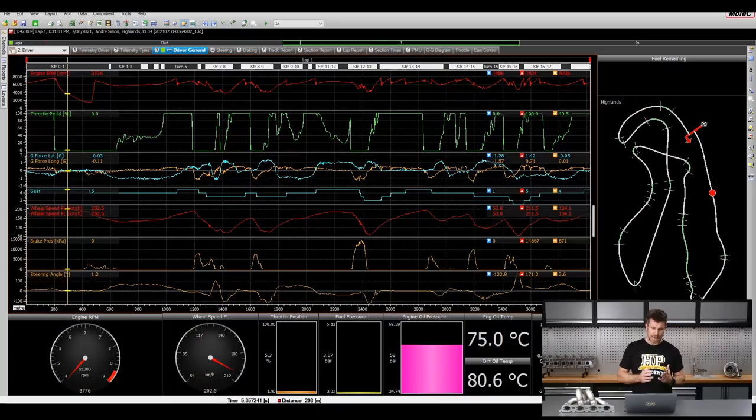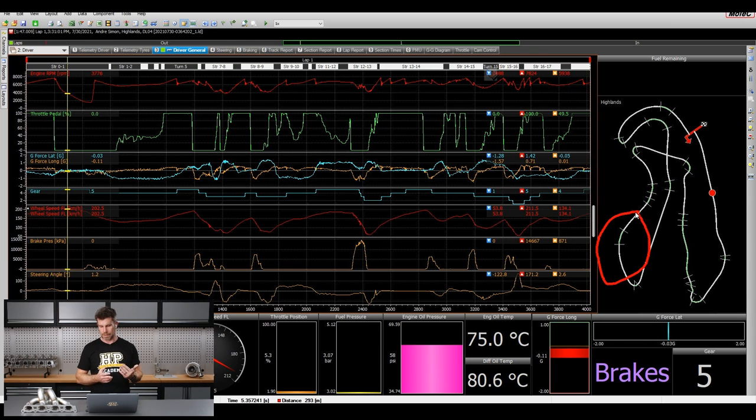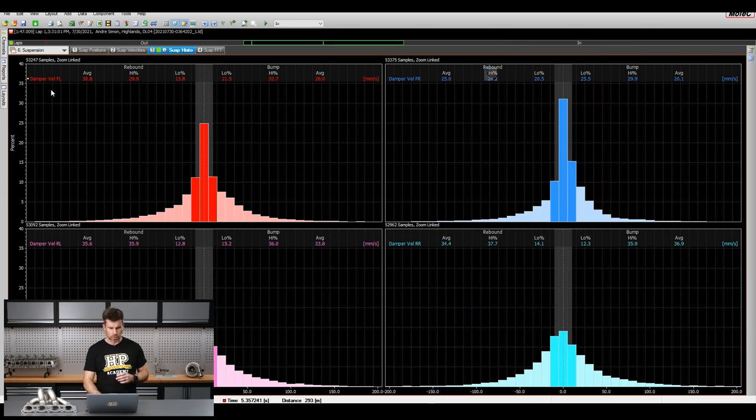Some other interesting aspects we found with the data. I'll switch across to i2 Pro here. Tim's been going through the data, and really this is just some cursory findings. We do now have shock travel potentiometers on the car as a new addition. One of the reasons we wanted those is to do analysis of the way the dampers are operating — we can see the actual position of the dampers as we move around the track. What we're doing here is a coast down test, essentially looking at the ride height of all four corners through our damper positions versus what we had stationary in the pits or at very low speed.